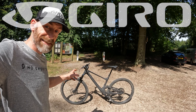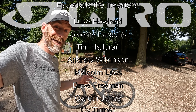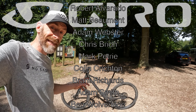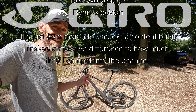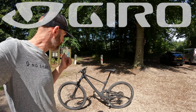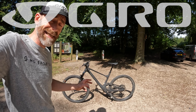Having the shock inside is new for this model, but otherwise it's a really well-proven and evolved suspension system on the back of this Spark and it works really well. The shock is on bearings — trunnion mounted — which makes it nice and smooth running. You've got an external sag meter: when you sit on the bike the little pointer rotates around and tells you roughly whether you've got the suspension set up right. Peel open the little rubber hatch and you can also see the travel indicator on the shock to let you know whether you're using the right amount of travel. It is a bit more tricky to see what's going on with the shock compared to a fully open shock, but the benefits in terms of long-term cleanliness, reduced service intervals, and longer-lasting seals are definitely worth a bit of inconvenience in setup.